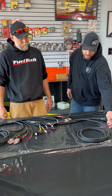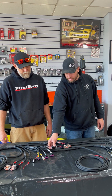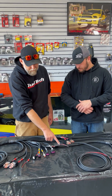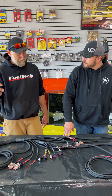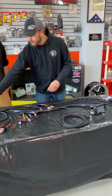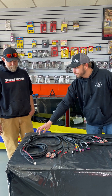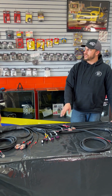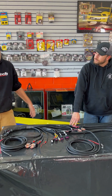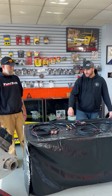All the load of the coil is carried in the power and grounds — these just tell it when to fire. The eight gray wires are your ignition outputs so they're going to fire every time it's ready to fire. For simplicity's sake, all of this is really inside the car once these two go to the bulkhead at the firewall. It gets really clean — you lose a little bit of this bulk — and it'll all be pretty much behind the dashboard other than your heavy power leads.